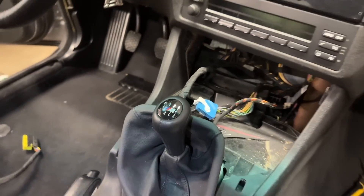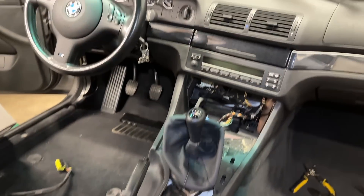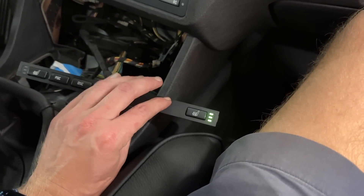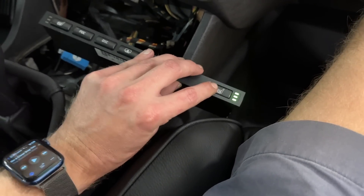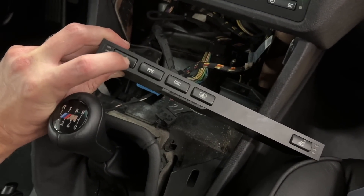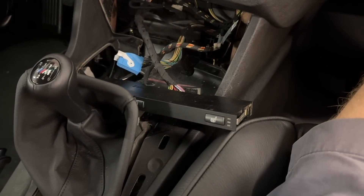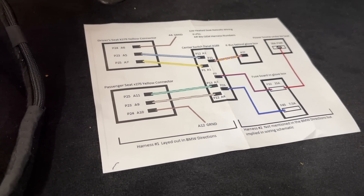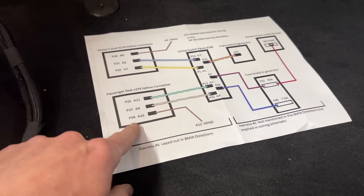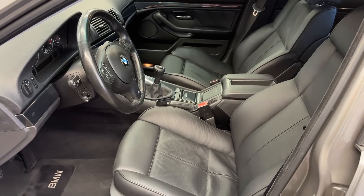Put the passenger seat in and test — success. In about two minutes this seat starts getting quite toasty. Important note: if your seat isn't plugged in, even with everything wired properly, the button will not illuminate; the seat must be plugged in for the system to recognize it. One correction: the ground wire goes in pin 24 on both seats — it's a large pin right between the other two. The seats go in exactly as they came out.